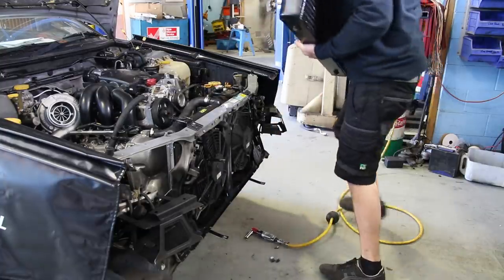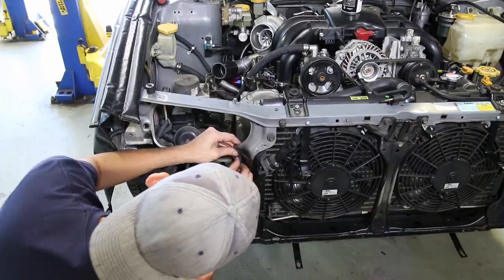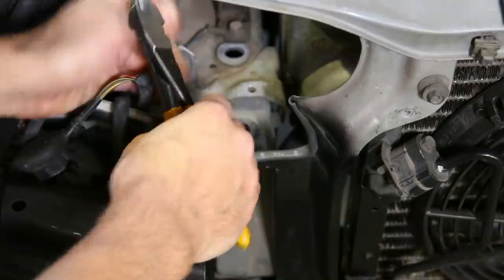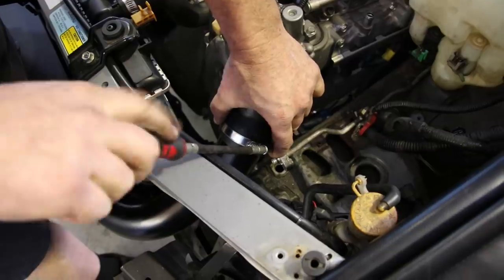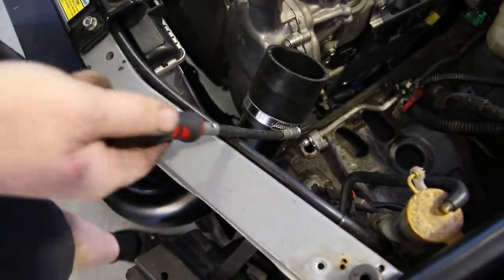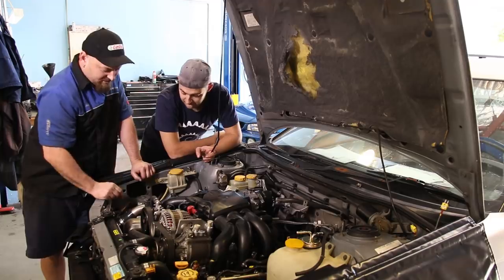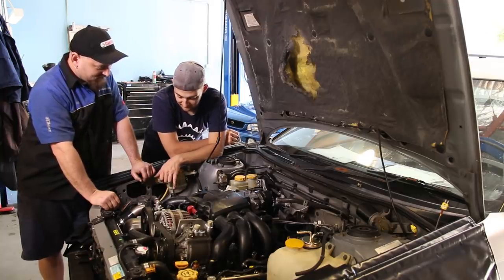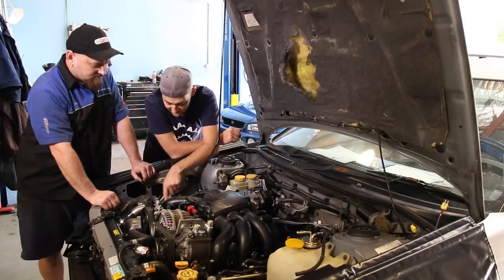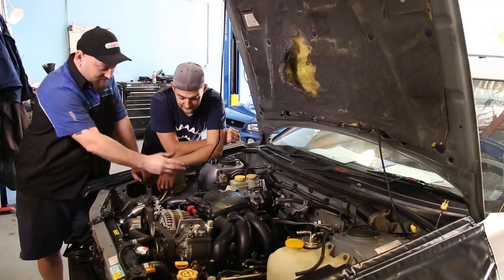We're painting the pipe black to match the intercooler for some extra stealthiness. We're using old recycled vacuum lines from a twin-turbo Legacy to protect our new pipe from sharp edges, which will prevent our black paint being rubbed off. Our cooler can then be attached to the car for the very last time. This one's going to be very simple - just a couple of 45s, a bit of straight, and it's done. Simple is the best way to do it when talking piping - short and simple. On this side we've been able to customise our power steering so it gets out of the way, but we need to get over the ABS. We also need to allow as much space for the air filter as we can.